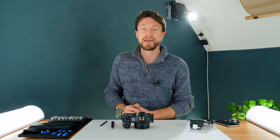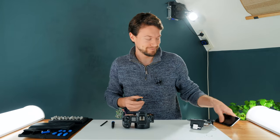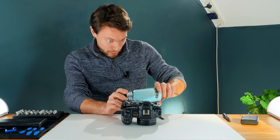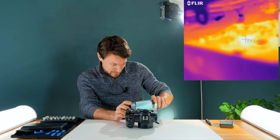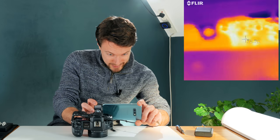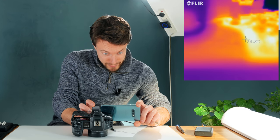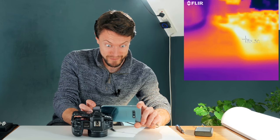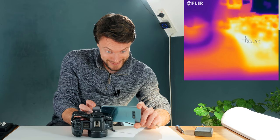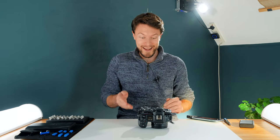I'm still not 100% sure the processor is the source of heat, so let's check with a thermal camera. The hottest part on this PCB is about 85 degrees Celsius — that is very toasty. The PCB area around the processor itself is about 82 degrees Celsius, and that's not the processor itself, just the PCB area around it. That definitely does look like it's getting hot, and it sure looks like the processor is the cause.